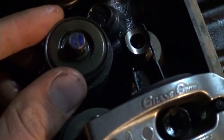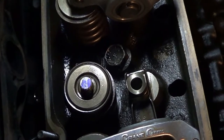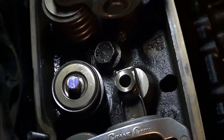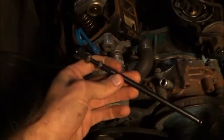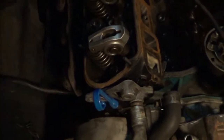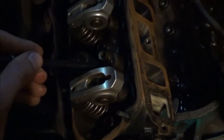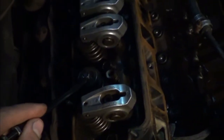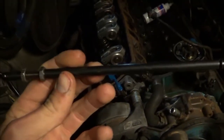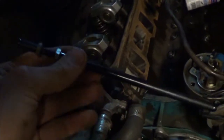And you can see right there it made a mark on it. You can see that mark is pretty much dead center on that valve. I just adjusted the push rod tool to the right length so that it wasn't walking around. Since these rockers went with this head, it was really simple. I just had to figure out what length these push rods needed to be. Sometimes you have to put shims under the rockers in order to center that mark on the valve stem, but I didn't have to. So I've got my push rod length and I can measure that. Luckily, there's a ton of options on Summit Racing for those.